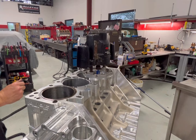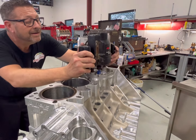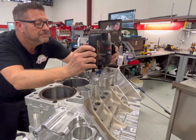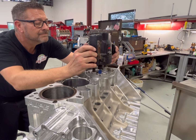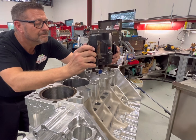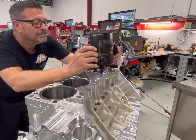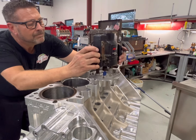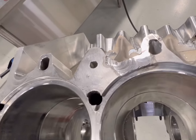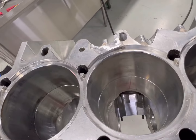The next step is kind of cool. I told you this was going to be a hand operation, so I've got this old router — I paid $5 for it at a garage sale. I got carbide router bits, the kind sold in kits for doing wood, all carbide-tipped. I've got one that's about an inch and a quarter in diameter, and I'm going to surface the top of this block with it, get it really close, and then finish it by hand.